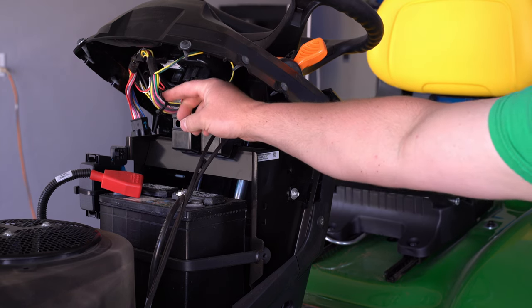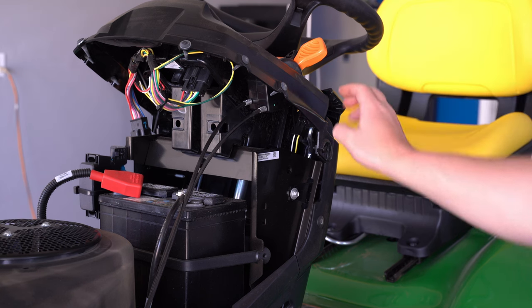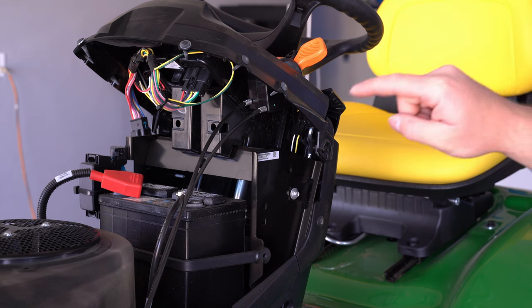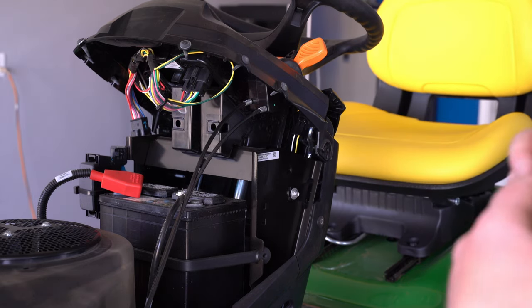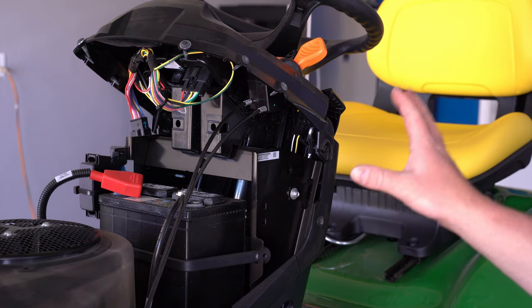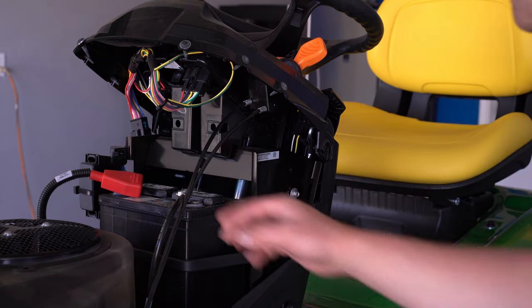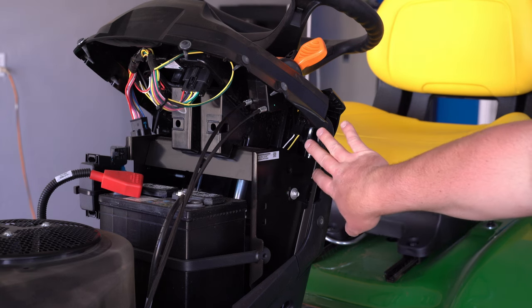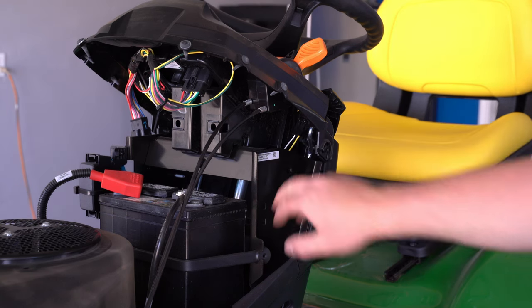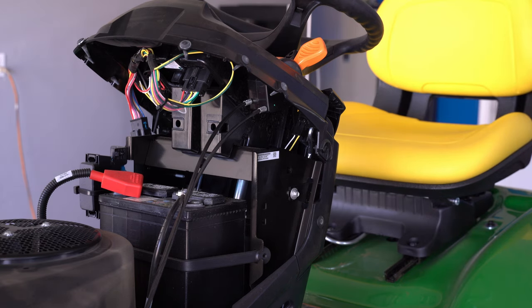And essentially, just so you guys know, the only thing that you're doing here is taking these two wires and connecting them permanently together. The difference is with the switch is when you hit that button, it essentially breaks and unbreaks the cycle of electricity flow between these two wires, telling the mower, hey, shut off, or you're good to go, keep running. So that's essentially the only thing that you're doing is making it constant, if that makes sense. Now, these don't have any electricity to them anymore, so there's no harm in just having them sitting there. If you wanna take this completely out, you can do that as well, but I'm gonna leave it there just in case anybody in the future wants to reconnect and it'll connect back working properly the way that it did before.